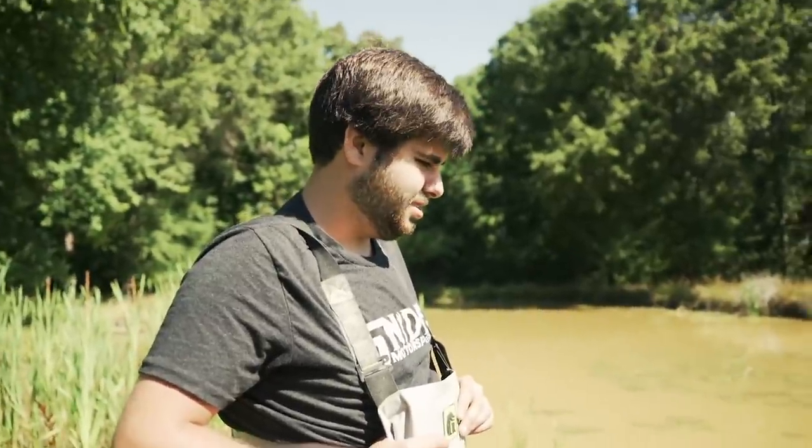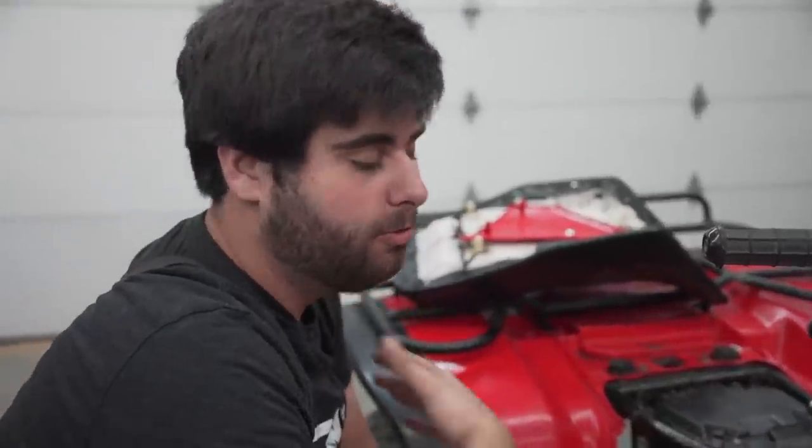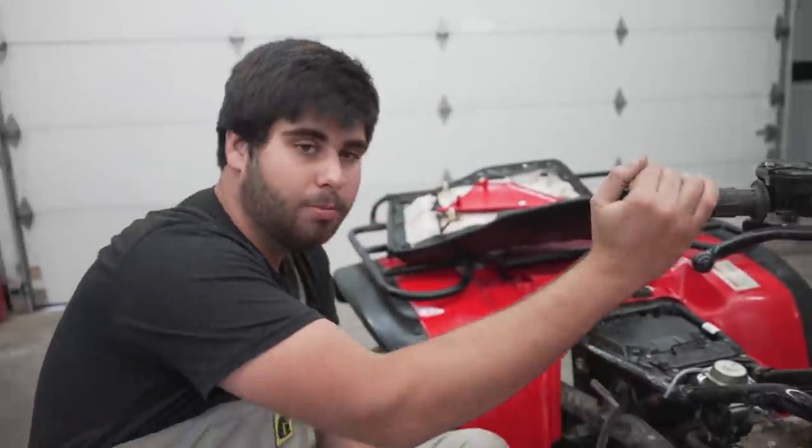Well, you sent it first try. No, you gotta plug. Send it. So, came back. My theory was correct. Drained the carburetor bowl, fired right up, ran flawless, no issue, right after the carburetor bowl was drained, which means bad gas, aka water's getting into the carb somehow.